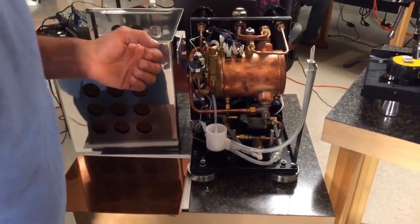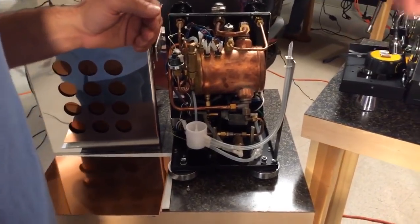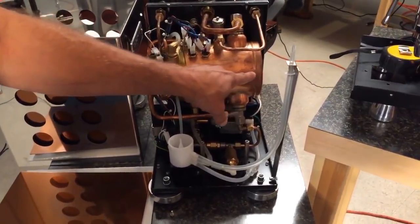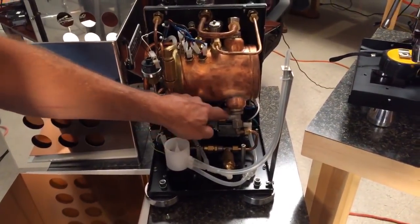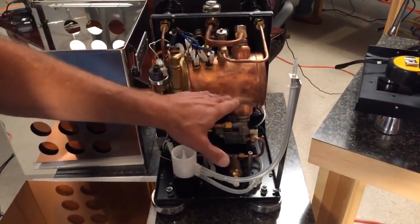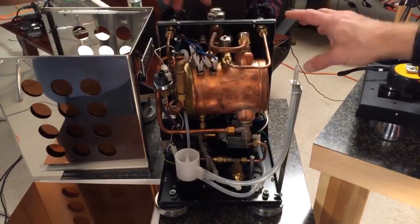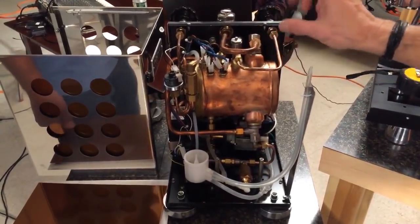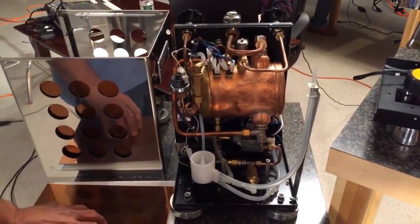Most people watching may know how a heat exchange boiler works. It's one boiler, but it creates steam and a lower temperature brew water — around 200 degrees, give or take. The reservoir water is used for hot water and steam dispensing. The water for brewing comes through a tube that runs through the boiler — it never contacts the boiler water, it just picks up the heat as it travels through and up into the brew group. These are engineered to give you the right temperature. Without PID, you might do some flushing before brewing, but they do pretty well — you can pretty much go right up and brew and get a pretty good shot.